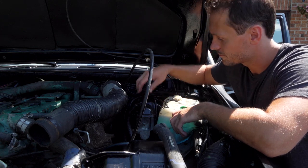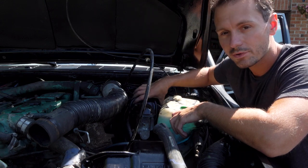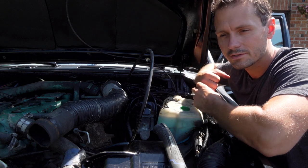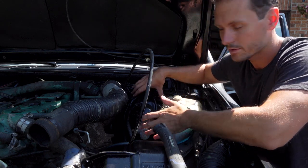So what you can do is you take the master cylinder out, and we're just gonna disconnect these brake lines, take the brake booster out, and then we're gonna use the brake booster and master cylinder from a 95 to 96 Cherokee, and you go from a single chamber to a dual chamber. So this is actually gonna be bigger, it's gonna be out here.